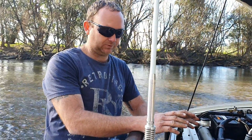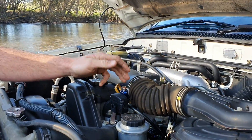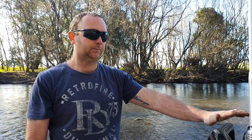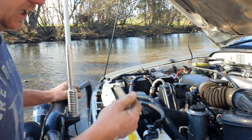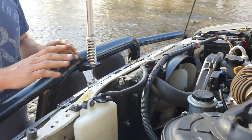It makes 18 pounds comfortably. I had to play with it and tweak it quite a bit to get it there — before it would not perform. I did have a spike of 20 pounds but it just wouldn't hold power; it felt like the fuel cut. Roughly set it about 14 clicks from off to clamp it, and yeah, it runs 18 pound quite comfortably. Even the missus was quite surprised at the difference. The turbo spool, the pull, the torque in fourth gear and third gear is sort of what it used to pull like in second, so the torque range and power band have changed. Don't know what it's like on fuel yet because we've only done it about two days ago. These things do have an electronic pump on them so you can't really fool around with them too much. There are people who say there's a resistor mod for timing and fuel, but I'm not playing with that — this is all I've done.